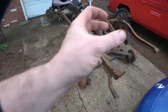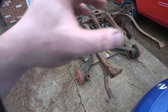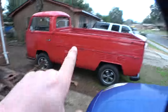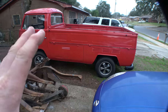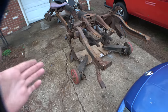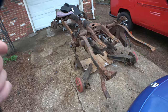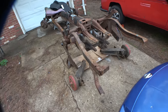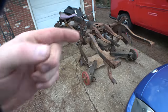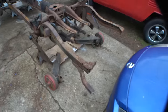I'd also like to somehow retain the reduction boxes with the IRS rear suspension — I don't know how yet, I'll have to do a little engineering. It's not something you typically see because the swing axle typically runs right into the back of the reduction boxes and it's all one piece, never meant to run IRS. Although some bay window buses in South America did have that. With the parts available to me here in the States, I'm probably going to have to do some machining work — fit a bearing, some type of seal, a spring clip — and then these Thing axles will probably get machined down to fit into the back of the reduction boxes. That's if I can even mount them on these trailing arms; I don't know how I would even do it yet.